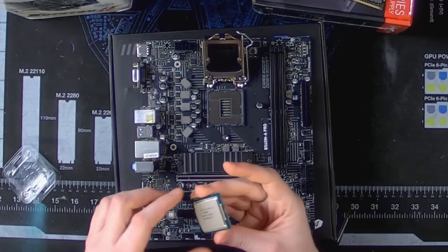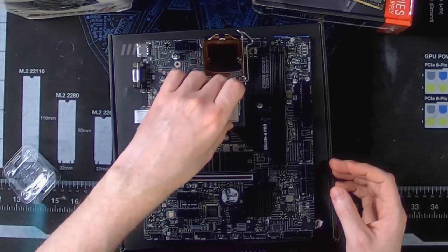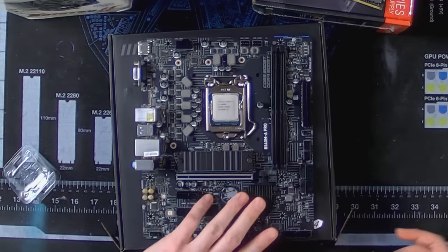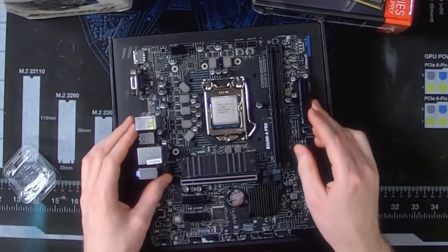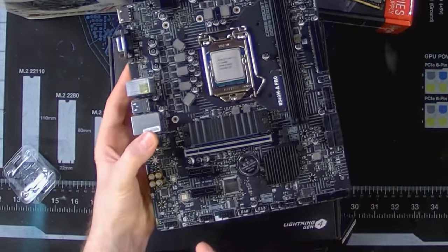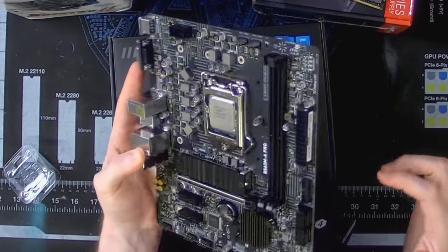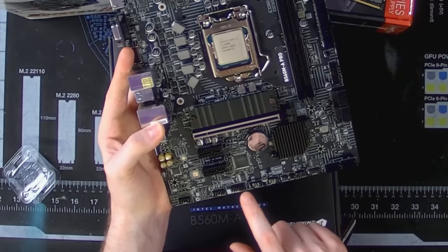Install the processor — line up your notches, which should be straight up and down on most of these motherboards. Give it the tiniest bit of wiggle and latch down. Save the cover in the motherboard box in case you need to RMA your board, since the pins are on the board with Intel. We've got two fan headers up top, and that is it for fan headers — we might have to get fancy with splitters. We've got USB 3 front panel, power, four to six SATA ports, front panel audio, and USB.